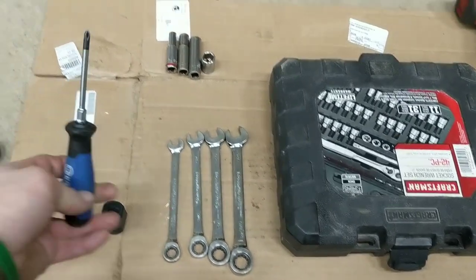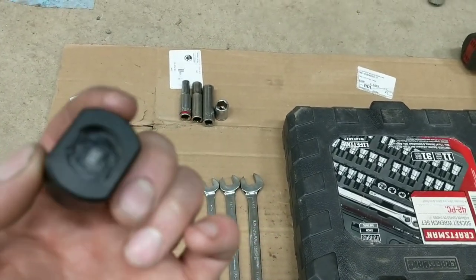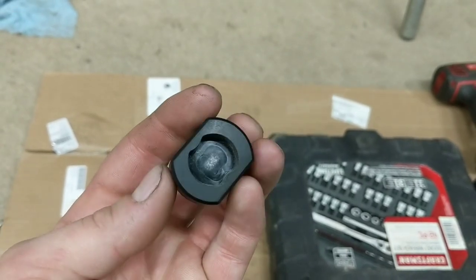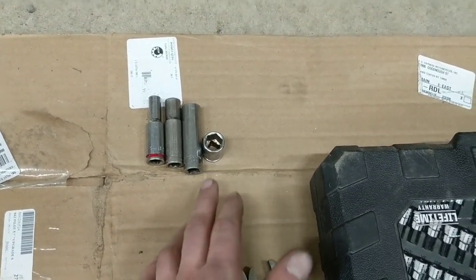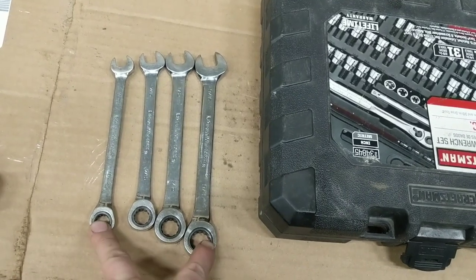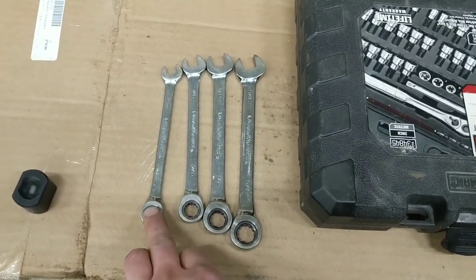Tools for the project: first, you're going to need a number one Phillips head — this removes the plug wires from their holders on the side of the engine. You'll also need a special tool from Boss Hoss to remove the unique hardware that holds the side panels on and the front radiator shroud. We'll need 8, 10, 13, and 14 millimeter sockets — or 9/16ths. Those will be used for random stuff on the engine. Ratchet wrenches also help, especially the 10mm and 9/16ths — the 9/16ths is used for the front fender bolts and they're a pain to access, and the 10mm gets used on one bolt on the front cover.